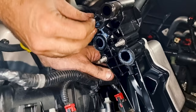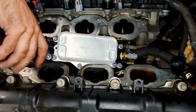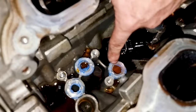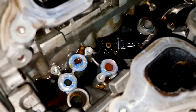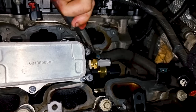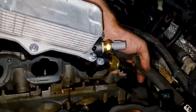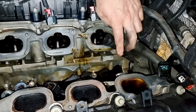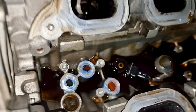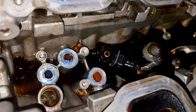Put a tray under the back of this because it's going to empty out a couple of litres of coolant — move it to the back of the bell housing and try and catch it as best you can. There's a coolant hose on the back — these will spill out coolant because they become the lowest point. Basically the valley is going to fill up with coolant and it's all going to run out the back, so you're going to make a mess of your driveway.